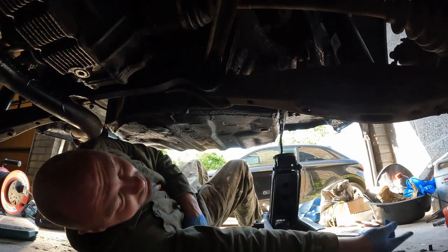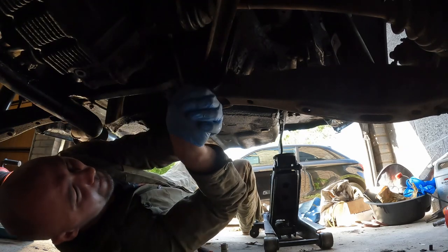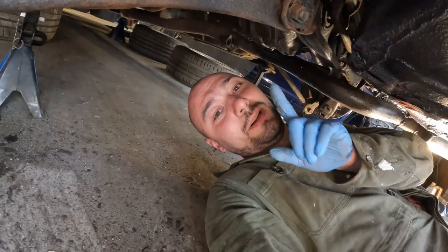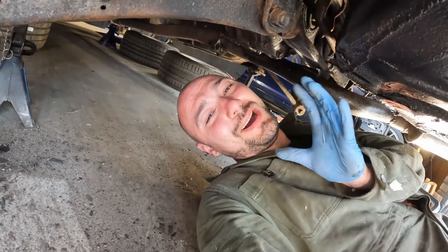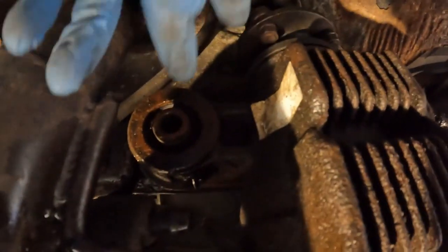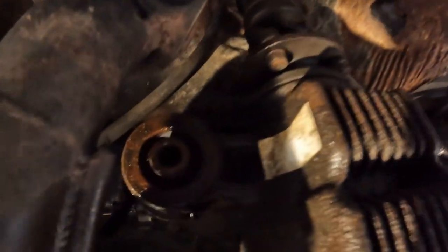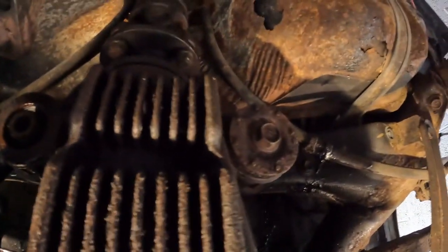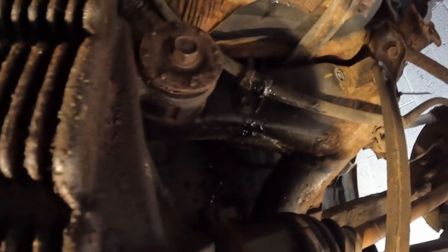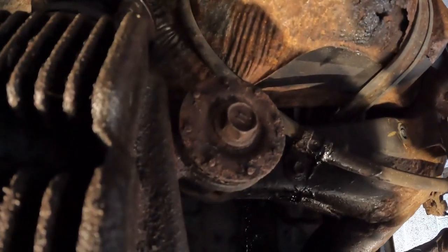Keep the hardware around in case we need it. I thought I knew why the rear was clunky — I lost one of the bolts that holds the diff in place. I tightened them really hard but apparently one went missing. I need to find a spare bolt. I'll probably order GT86 ones because I think they're a little bit shorter, so technically I won't be able to complete everything in one day.